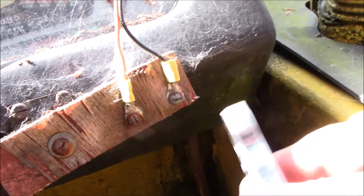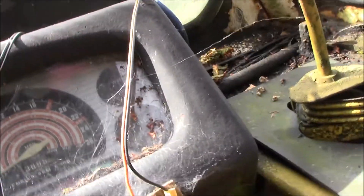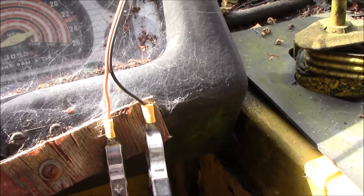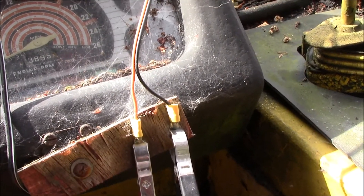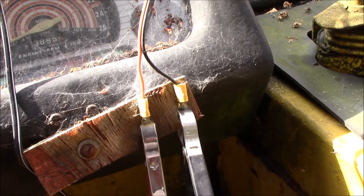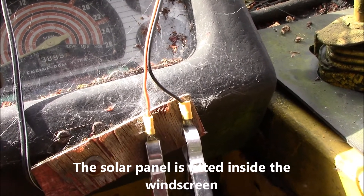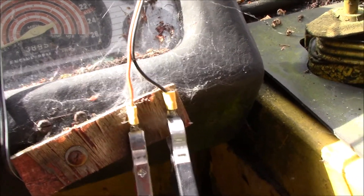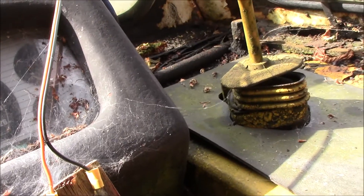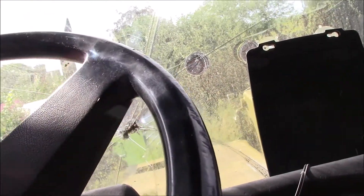While the vehicle is not in use, we connect up the positive connection here and the negative connection here. The power is then fed from the solar panel down through these two wires and down to the battery, so that keeps it charged up all the time. We obviously like to park the vehicle so that it, at least most of the time, is facing towards the sun. But even in the winter when the sun's not shining, daylight will provide some charge directly into the battery. Now because we can't start or run the vehicle with this connected up, all we need to do is disconnect these two crocodile clips.